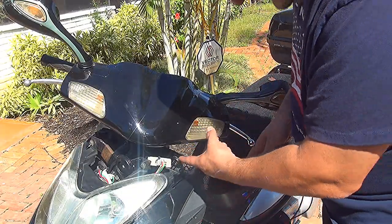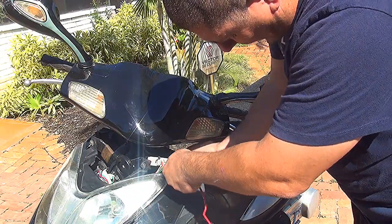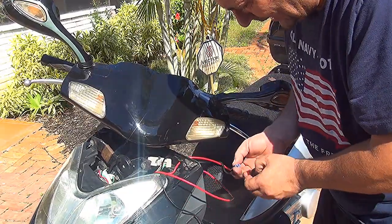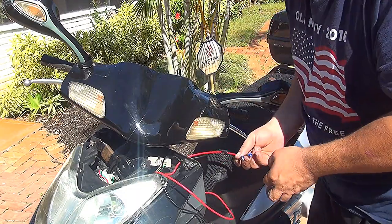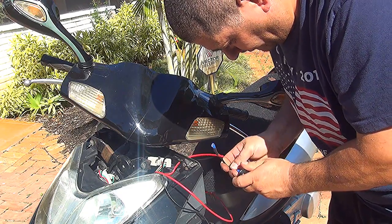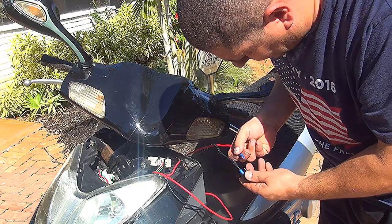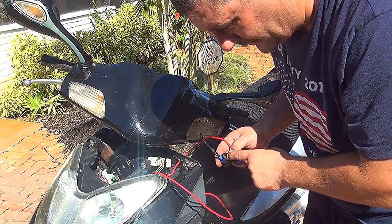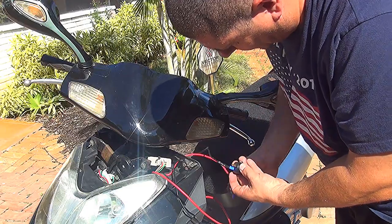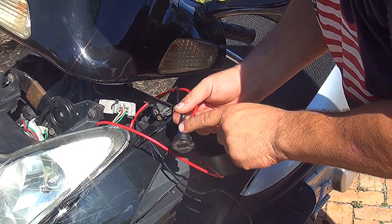Now, with your finger, just pop this one out on the other side, okay? So now pass these two wires inside the little frame of the voltmeter, and you want to attach the wires, the black one to the black minus right here. They're kind of hard to put in, but it's okay, that's better. And the red one on the plus side of the multimeter right here. See, this is how you have to connect your voltmeter, okay?